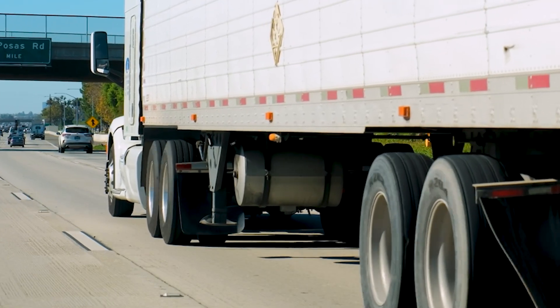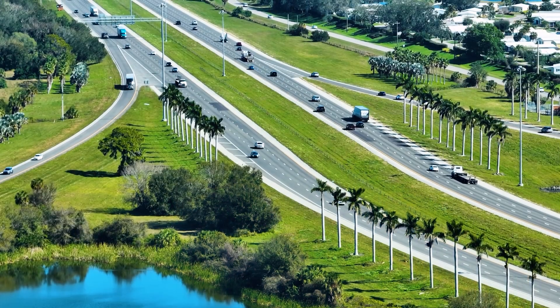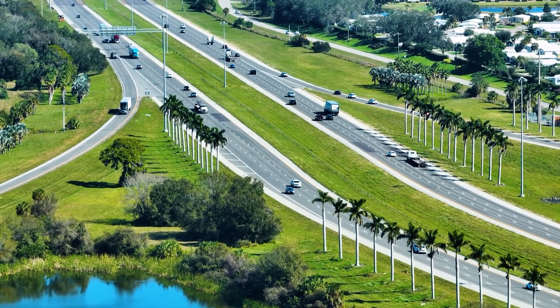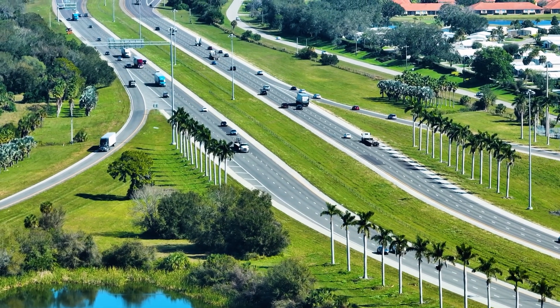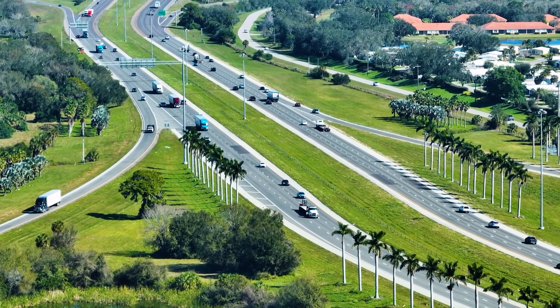At the very least, you'll degrade the casing and compromise its retreadability. The sun beating on the sidewall also causes ozone damage, which is something to be on the lookout for. Certainly in Florida and the South, with excessive sunlight and heat, you're going to have ozone damage and cracking on the sidewalls. Basically, the heat and everything causes ozone cracking.